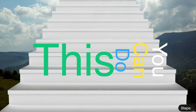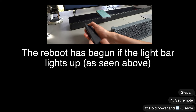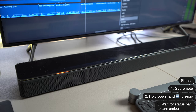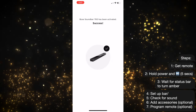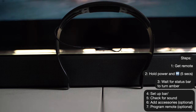Here are the steps with the Bose Soundbar 700. Grab the remote and hold the power button and skip forward button for five seconds. You will know the system has reset when you see the light bar glow solid amber. At that point, go ahead and pretend you have a brand new bar. Go through the guided setup process on the Bose Music app, re-add the accessory speakers, and program the remote to control your TV and Blu-ray player if that's your setup. After setup, there's a great chance your soundbar will be recognized by the TV, and you can continue being a productive member of society.